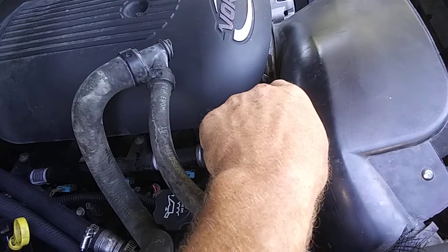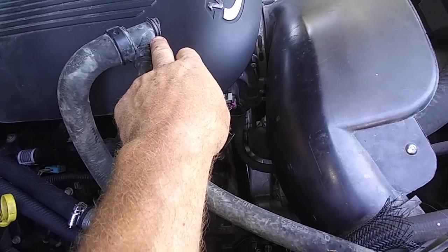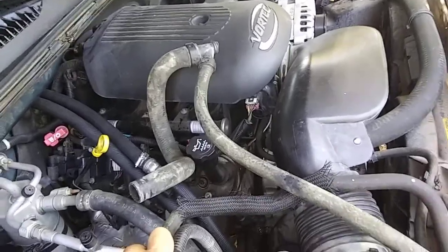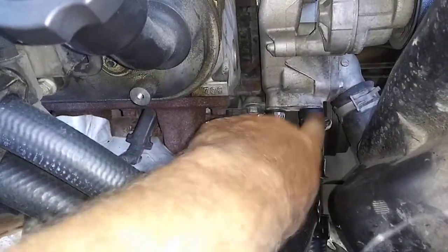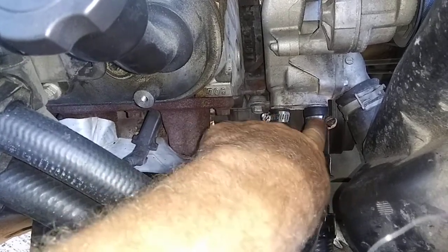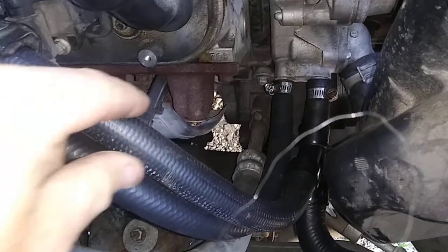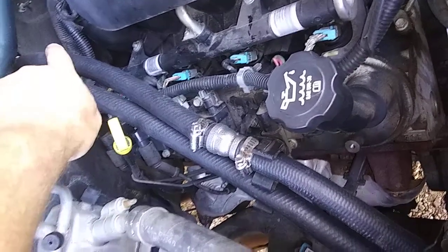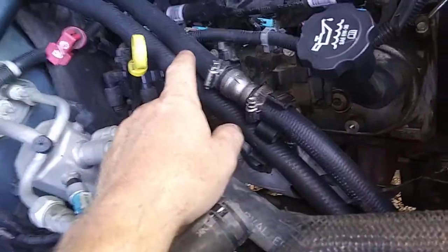So I had to go buy the Gates one from O'Reilly's. I did go to the home improvement store where I work and bought made-in-America hose clamps. I quit buying the ones from the auto parts store and Walmart because they're made in China, really thin and horrible, and they strip out. Instead of using the horrible factory clamps that rely on tension, I put worm clamps on these. The hose that comes on the piece from O'Reilly's is five-eighths, but the problem is five-eighths won't fit over the built-in lock ring that's already on the tubes.